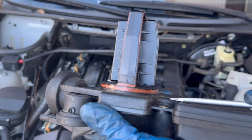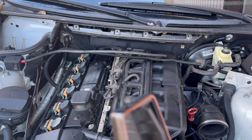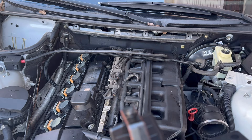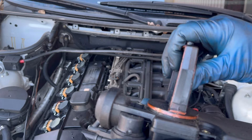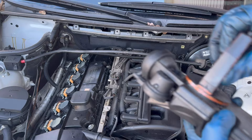We should be able to pull this DISA out nice and easy. This looks like it's the original O-ring because it's actually formed in place — it's not a real O-ring. Contrary to internet belief, this pin cannot fall into the intake while it's in place. Simply measure the depth; there's nowhere for it to go. Now, this can fall out as you're pulling the DISA out or putting it in. To test the flap, there's a little vent hole — close it, put your finger over it, it should hold. Then open it — the diaphragm is good.